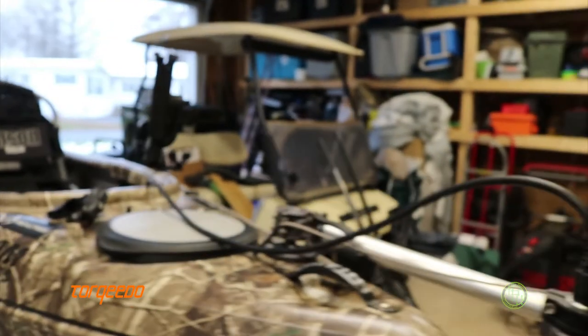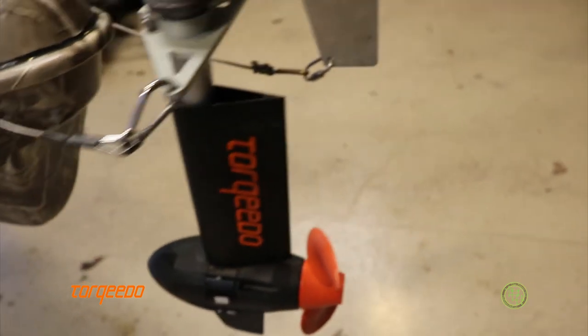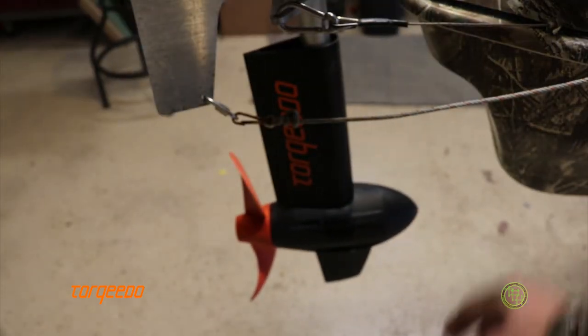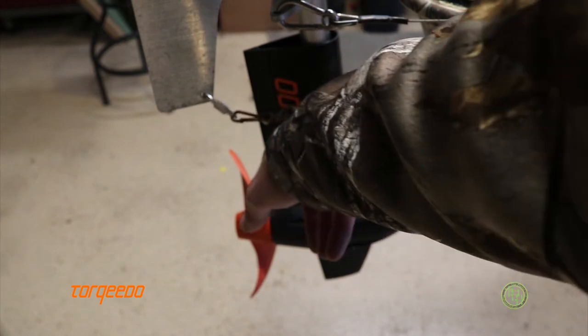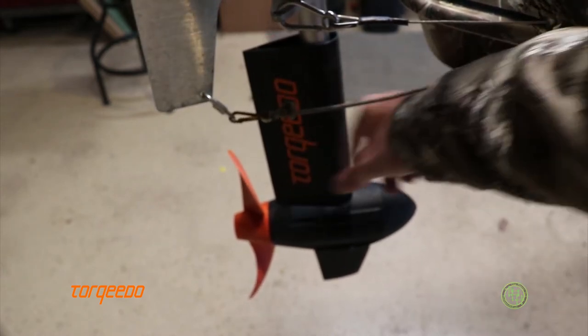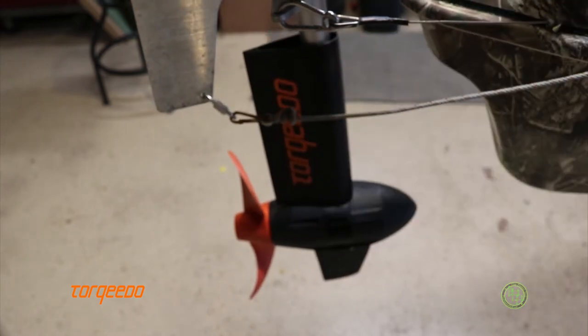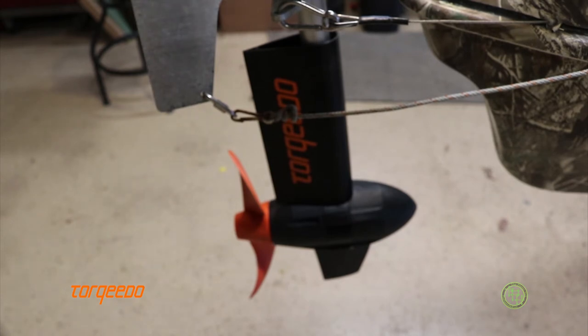Now the last two things down here at the motor. On the OBE forums, a guy came up with this idea because we noticed cavitation with the pipe here — the water, how it swirled around the pipe, would actually pull air into the prop and make it cavitate at high speeds. Putting this here makes the water wrap around and it doesn't pull any air. What it is is a Yakima wind blade for a roof rack to knock wind noise down — same effect, but underwater. I just painted it on mine to make it look nice. It's $15 to $20 on eBay — great addition.